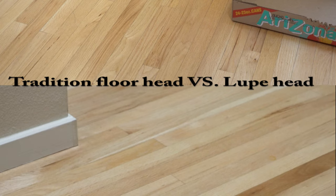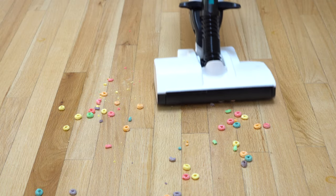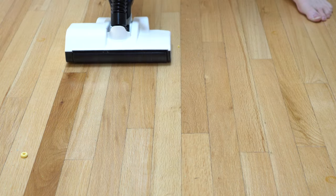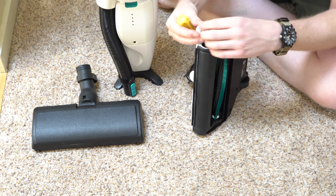The reasoning behind the soft roller is for big objects to pass through — it squishes down — but that also pushes the object into your floor, potentially scratching it, versus just using the straight suction of the machine. Of course this is a cordless machine, so it doesn't have a whole lot of suction. They did borrow an existing brush roller out of a robotic vacuum, which is a questionable decision.